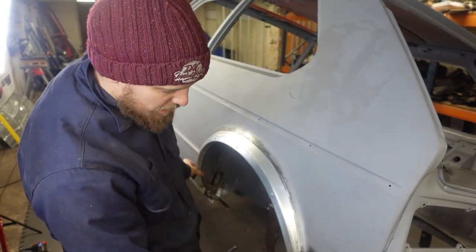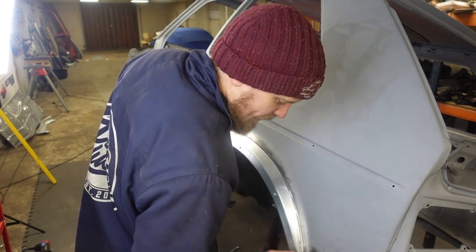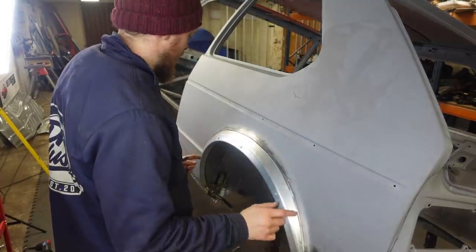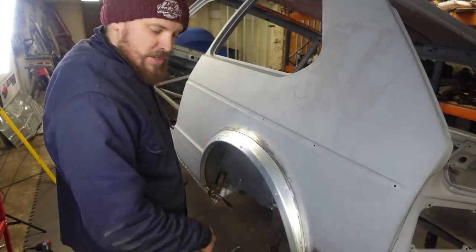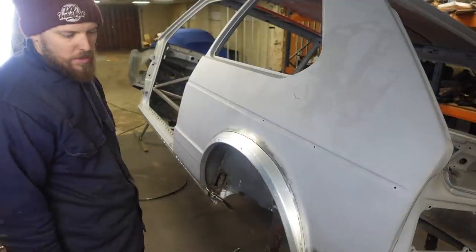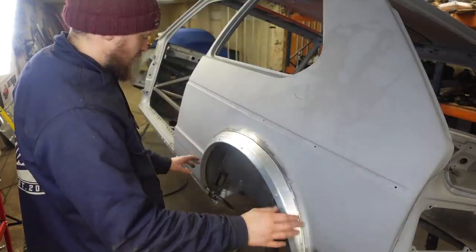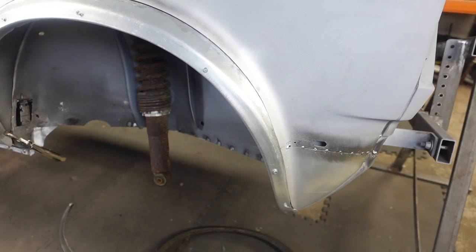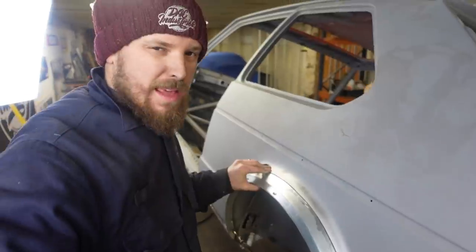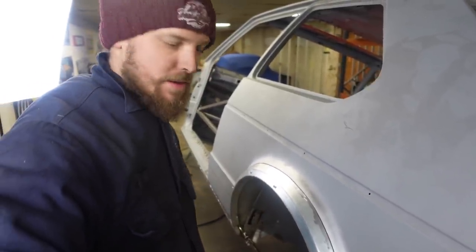There's the arch piece on — all cut in, sitting where it needs to, but needing a bit of manipulating. As you tack and weld it you can push and pull it to get it in the right place. There's a nice gap there but it's a bit close in some spots, so I'm just going to go back through with the grinder like I did on the rear corner and the sill. We'll make a bit of a gap, get it all cleaned up, painted, and then start tacking this bit on. All trimmed, primed, sorted, screwed back on into place — just needs a bit of pushing and pulling to get it bang on. We'll manipulate it as we're welding it on.